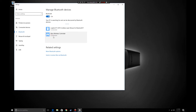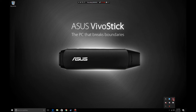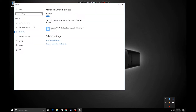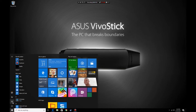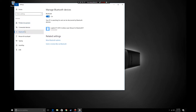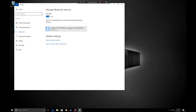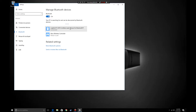This is if you're lucky enough to have that option pop up. But if not, let me run you through some other options. Down in the bottom right-hand corner, you can click on the Bluetooth icon and you might get a pairing prompt. Or you can do it the old-fashioned way through the Start menu — click on Settings, then Devices, and on the left-hand side you'll see Bluetooth. Press the pairing button on the controller, and it will pop up here. Double-click and click Pair, which will find the Windows drivers and pair the device to the PC.